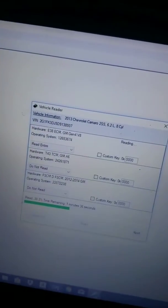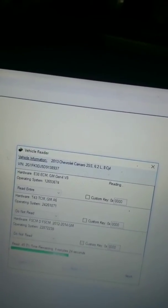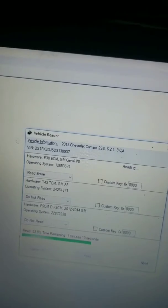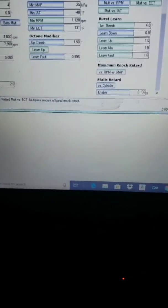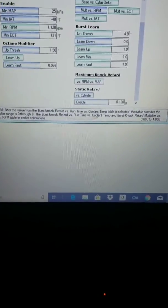Right now I'm reading my ECU — just the engine, not bothering with transmission or fuel pumps. I've done so many logs and tunes that I'm not sure where I'm at, so I'm doing an as-found read. Any changes I make will be as of today. I also adjusted my knock sensor settings slightly — a previous tuner had zeroed out timing pull down low and I didn't like that, so I added two degrees total timing retard.